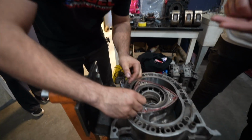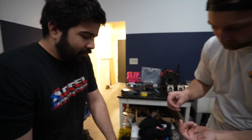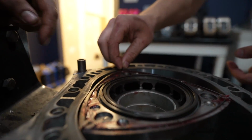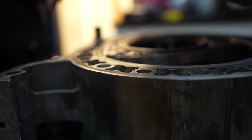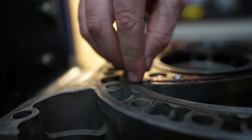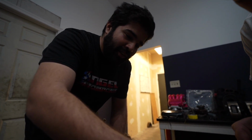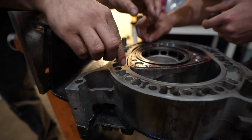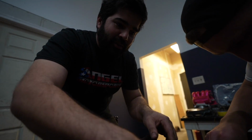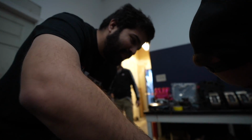Springs, you need to set them back in all the way. So you push the springs in. You remember how it had that little leg to hold the spring in? Same thing. Start from over here and ride it in so you can feel the spring getting pushed on. Now these will allow themselves to wear into the correct position. They are on a spring, so this is another thing people mess up on. While you're building it, it's going to move, and you saw it pop out like that. Usually I'll put some assembly lube on it to keep it from shooting out, because while you're moving this, it might shoot across the room. And you'll find out after you turn it on.